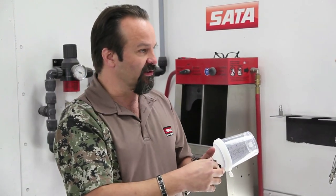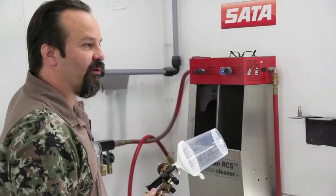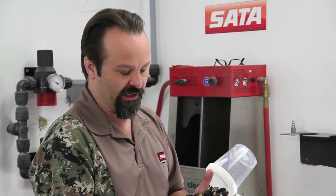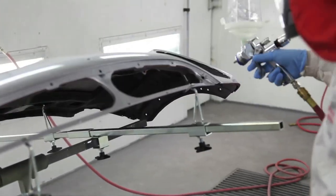You may also have a dry-to-drive condition when you spray clear. So what we always recommend is to leave your micrometer as close to open as possible and adjust at the wall. If you've got a regulator at the wall, set the pressure closer to your operating pressure. On a clear coat gun — if I'm going to shoot clear with this RP 4000 — I might spray at 26 pounds. But if I've got 70 coming to it and cheat it down, I'm going to have the problems we talked about.